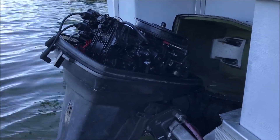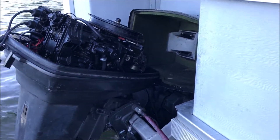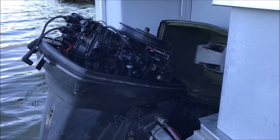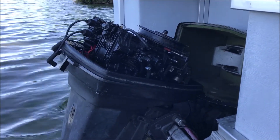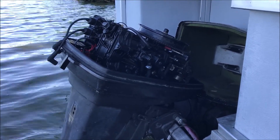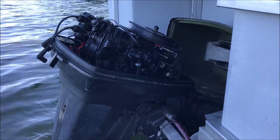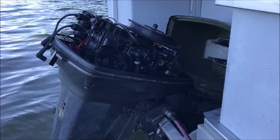So I came down here this morning and I pulled the spark plugs off, and I dumped about a teaspoon of two-cycle oil in each of the cylinders. Before pulling the spark plugs, I went to the book and checked to see what the spark plug model should be — and it's not the model that it should be. This particular motor calls for a Champion L76, and this thing has NGKs in it that cross-reference to L78. So I suspect since they cared enough to spec an L76, it's not the same as an L78, so I'll make a run and get some L76s. In the meantime, I have this thing sitting with oil on top of the pistons.